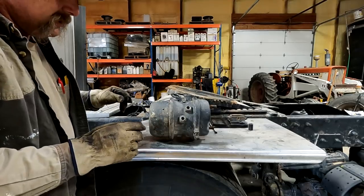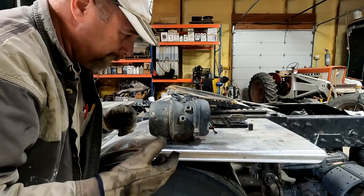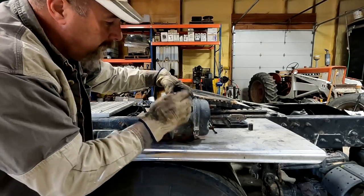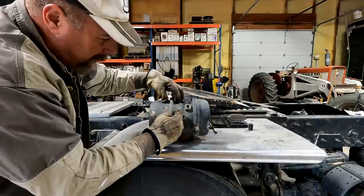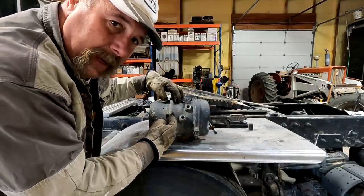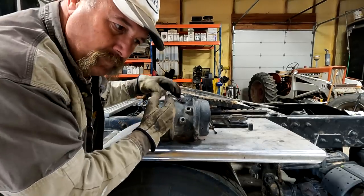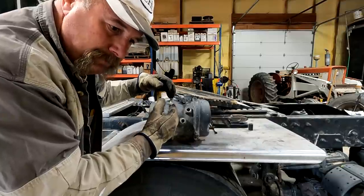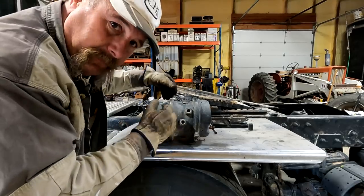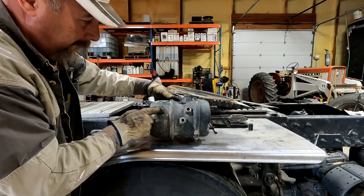All right, what happens is, when you pop the brakes on the dash, and you hear that push, brakes popping, okay? What you're doing is releasing all the air pressure that's built up in this center chamber here. There's air pressure builds up in here, and there's a diaphragm, like a bladder, or what I've referred to before as a pancake. It makes a seal for air. Air can't pass. All right, so anyway, this diaphragm sits in here, and there's a big spring in here, okay?